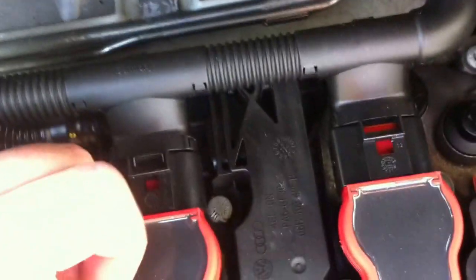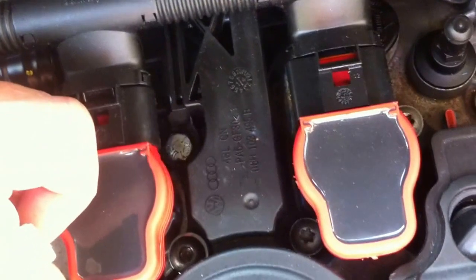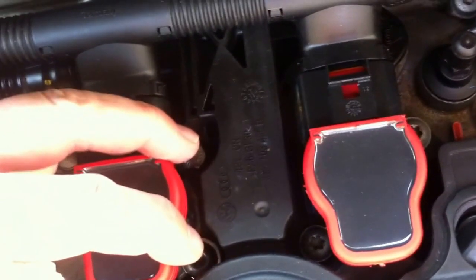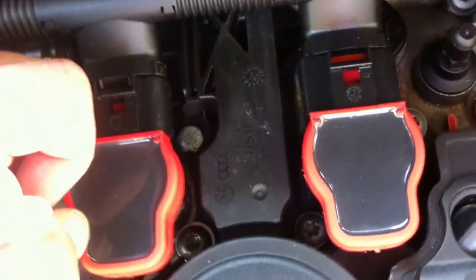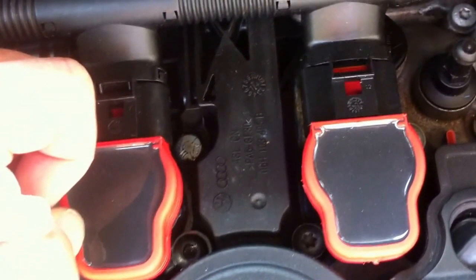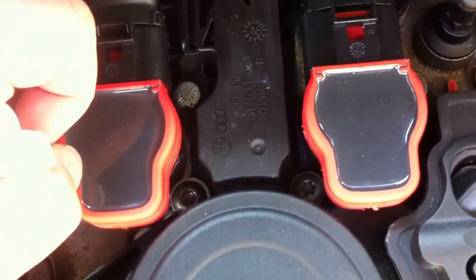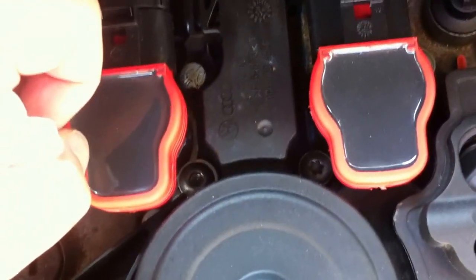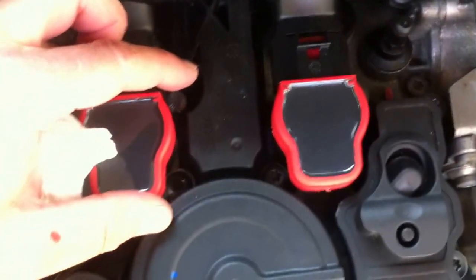What happened was there's a couple bolts down here. You can see they replaced this bolt, and that's an oversized bolt as well. And these were stripped, so oil is leaking back here. So they re-threaded those at my garage, and put this back on, and I torqued everything back to spec again.